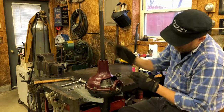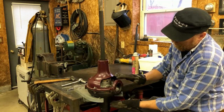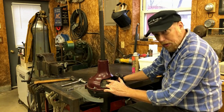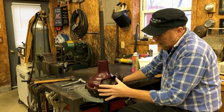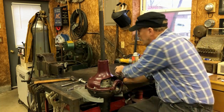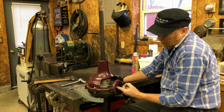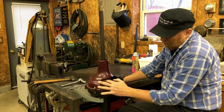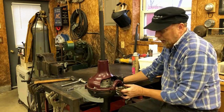There's actually two washers and a bronze washer that goes on the bottom and on the top. Originally this would have been a Babbitt washer — they were okay back in the day but they did wear out. What happens when they wear out is this whole unit will start moving away from the pinion, so the pinion gear will actually move away and this won't rotate anymore. So when you rebuild one of these, you always put the bronze washers in there. This is where the drive shaft goes.